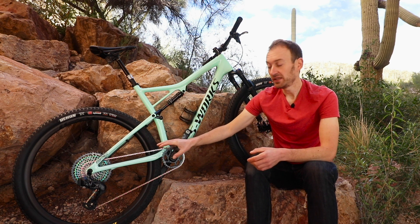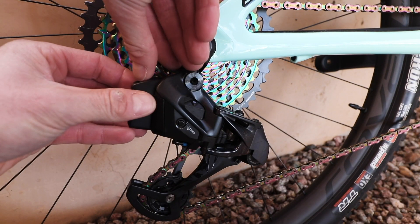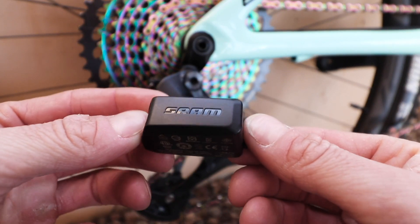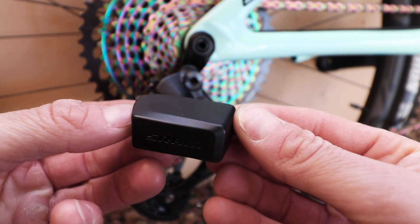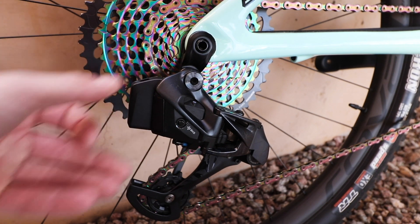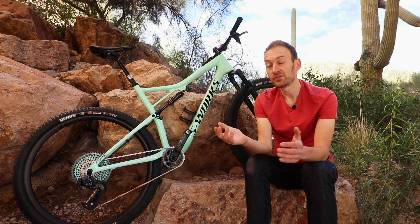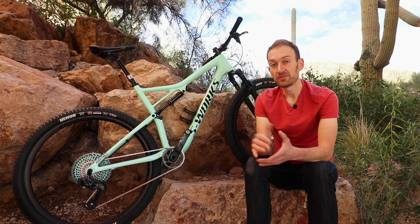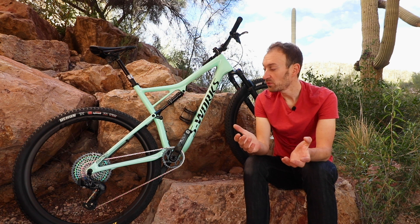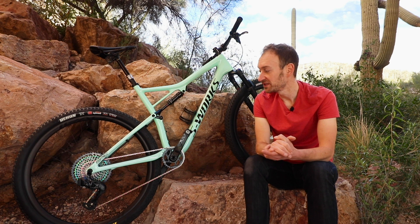You've got the same Eagle technology with a wide-range 10-50 cassette and a familiar-looking rear mech with a battery on the back. The battery is removable, and you also have an electronic Reverb dropper post that uses the same technology — the same battery — and the batteries are interchangeable. So if you're out riding and the battery dies on your rear mech, you can simply take the battery out of the dropper post and slot it in. For epic long or multi-day rides, you can carry a spare battery in your hydration pack. Battery life is pretty significant too, so you have to go some way before you run one flat.